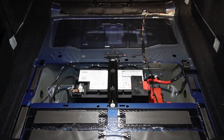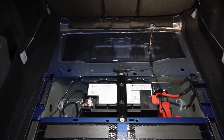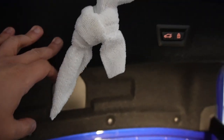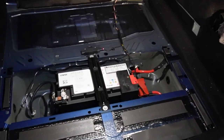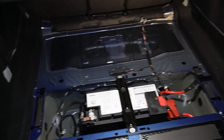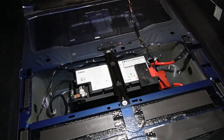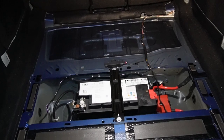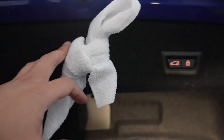Although this step is optional, it's highly advised to disconnect the battery before you unplug any DME connectors. It's also optional but highly advised to wrap a microfiber towel around your trunk latch in case the trunk gets slammed shut. My car has a power trunk, so if it closes I'd have to climb from the cabin to reconnect the battery terminal. That's why it's advised to wrap a rag over the trunk latch — a knot like this will do.